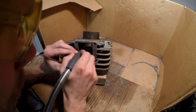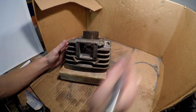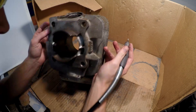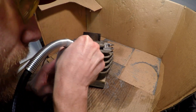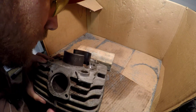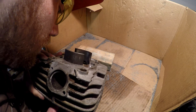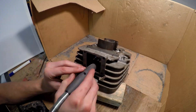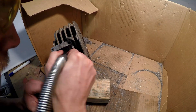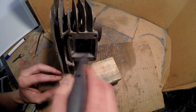These DT175 barrels have tons of potential. Pretty much the designer at Yamaha designed a super fast 175 air-cooled two-stroke, and the castings and cast iron have really good timing — but then the aluminium behind that doesn't match up. They've got big lips and all sorts of restrictions to help with emissions, which is great news for us. All we're going to do is smooth out the transitions from the intake to the cast iron, remove the obstructions, and we'll get ourselves another three or four horsepower out of a super peaky DT175.